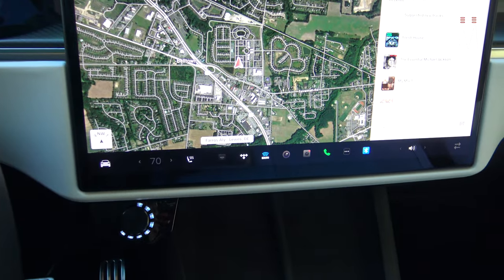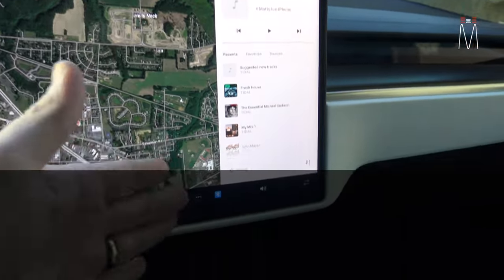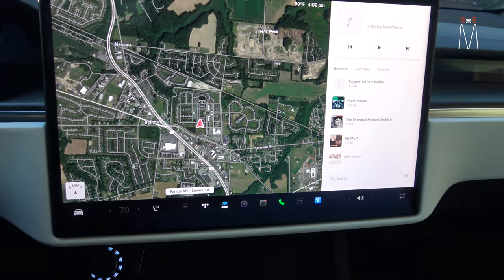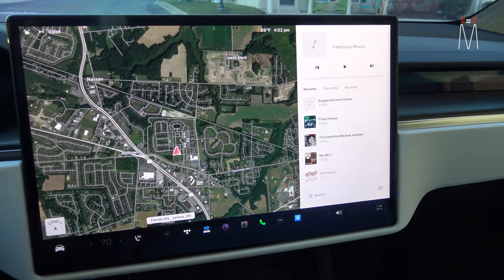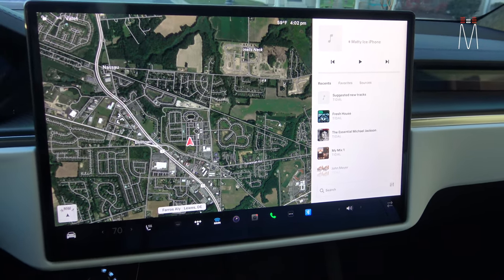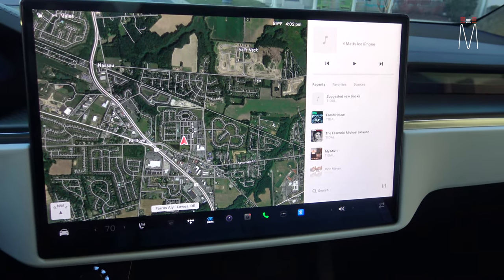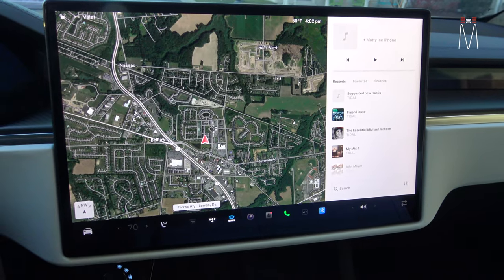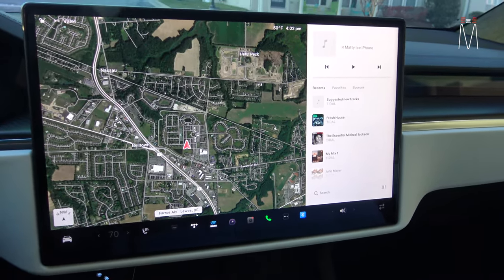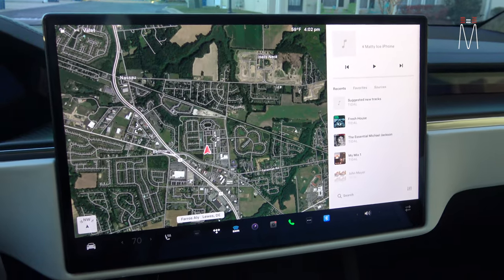Now to talk about the different presets. Preset one is the factory radio — the factory MCU operating exactly as it does from the factory. Everything you listen to on this will work through preset one, just sounding better. One thing to note: with Tesla updates, Tesla will sometimes change the factory EQ curve and response. They might do an update that says 'improved Hi-Fi stereo' — all they're doing is adjusting the EQ curve to kind of trick you into thinking they've made improvements. The audio is something they're also continuously improving with updates, so that's something to think about when adding an audio system.